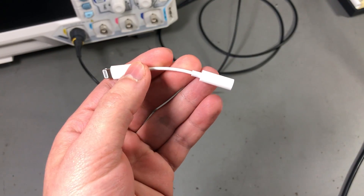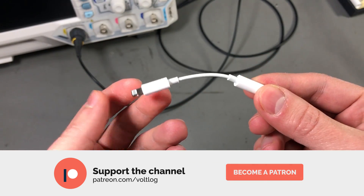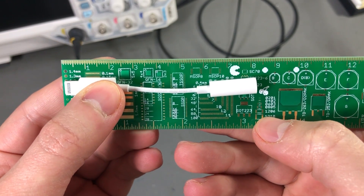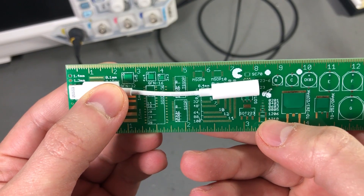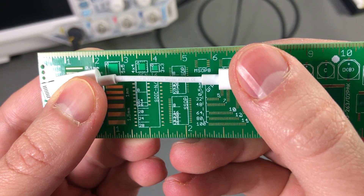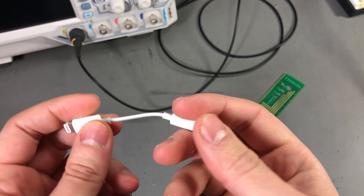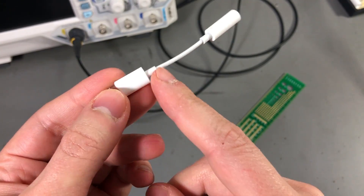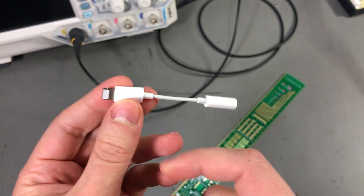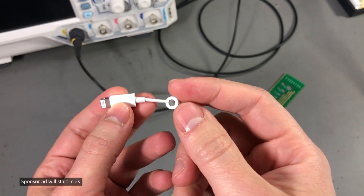Here is the genuine adapter that comes with the iPhone. It's very small and likely it will break easily, or even more likely you will lose it. It's pretty short with thin cable, and it has some writing on it: assembled in Vietnam, model A1749. But this is not just a simple wire adapter — it contains electronics to talk to the phone and an actual digital-to-analog conversion chip. The phone sends digital data and this small adapter converts that to an analog signal and amplifies it for your headphones.